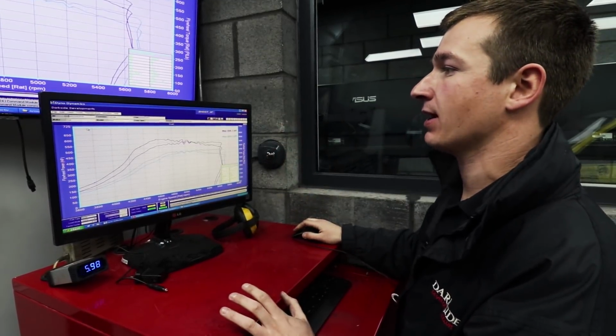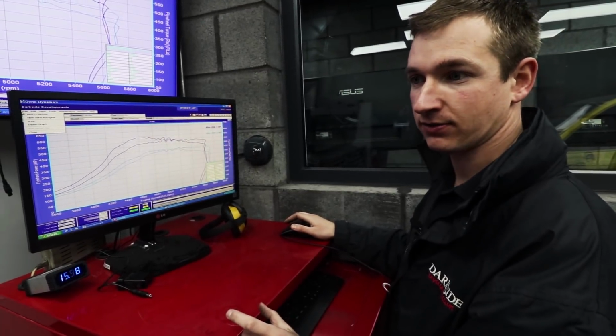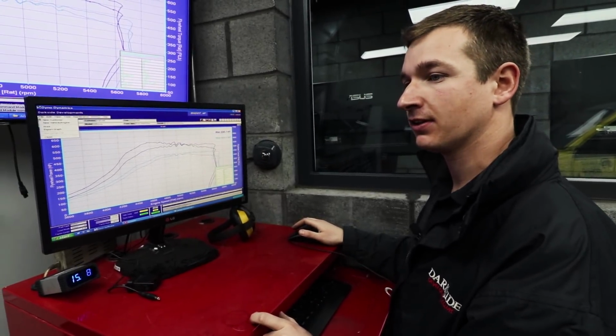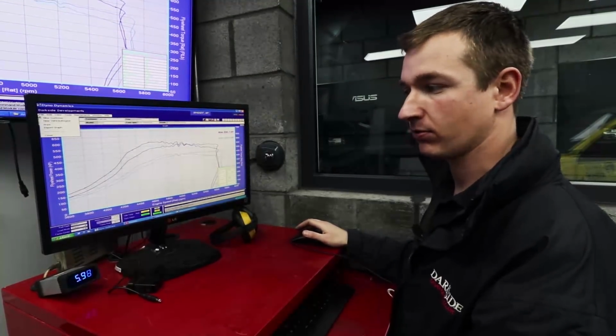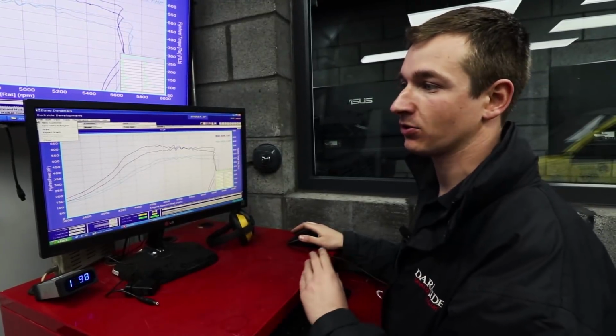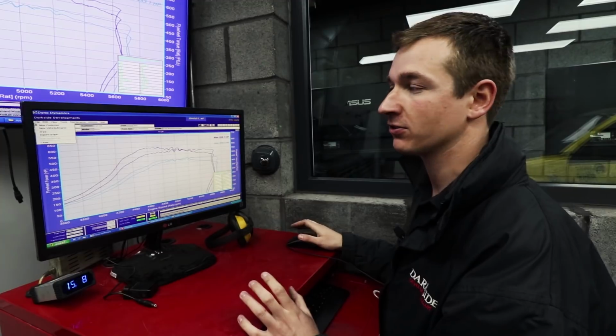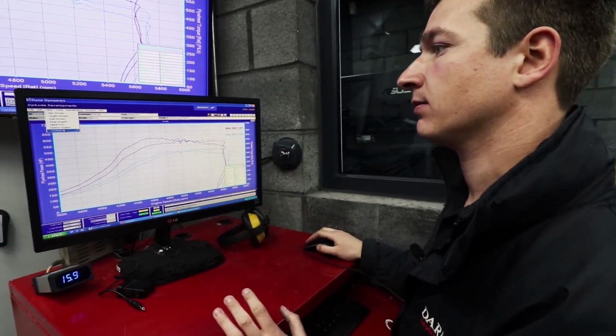So running the same amount of nitrous, putting these new injectors in, running less duration, the same rail pressure, for the same EGTs it works out at. So we're going to be getting more fuel, the same EGT, so it's burning as efficiently, so we're not going to be causing us any problems. We got this. So where are we?